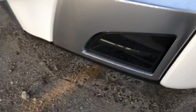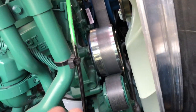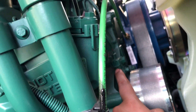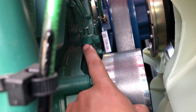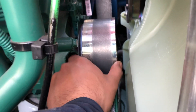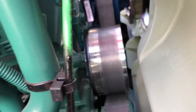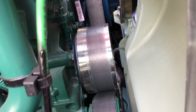Now let's go around — we have an updated water pump. As you can see, this water pump now has a magnetic clutch on it. There's a connection for the magnetic clutch, and the pulley is bigger compared to the older one. I'm not sure if that's good or bad; I've changed a few on Freightliners but not this one yet.